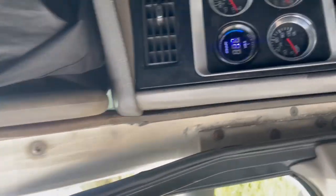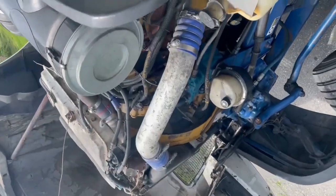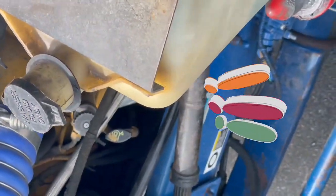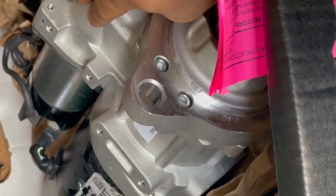See if you can hear the engine. It's not gonna turn on, but you're gonna hear it spinning. Here we go. Here's the spin. I'm gonna make a video. I don't have the stick. So the spin means the starter is good, but it's getting stuck in here. You can hammer it if you've gotta go, but it's not good in the long run.